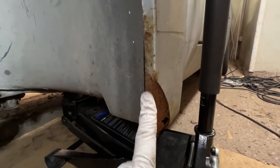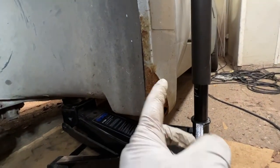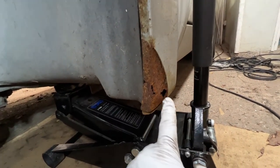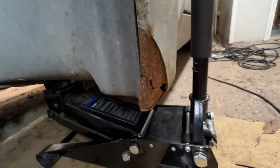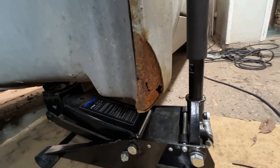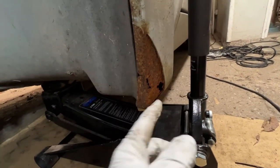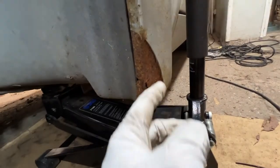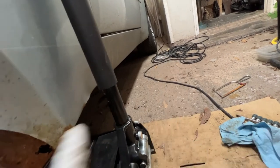So these wings have been repaired. Now that in itself isn't a bad thing. The wings are notoriously difficult to get hold of, and they're about £1,500 to £2,000 for a new OEM wing. So it makes a lot of sense to repair them, but what's been done by the looks of things is there's been a rust hole, somebody has just sanded it back, stuck a big chunk of filler on it, and then repainted it. And all that's happened is that's just rotted out from behind again, because this isn't a very good seal, it's an old car, this isn't all perfectly fitted. Whereas what they should have done is cut the rusty metal out, treated what was left, and rebuilt up with new fresh metal, properly coated it to stop it continuing to corrode, and then put a skim coat on and painted it. So this has been a bit of a bodge, and it's the same kind of at the back of the sills over there and on the other side.